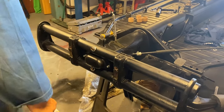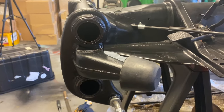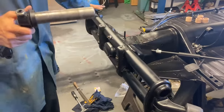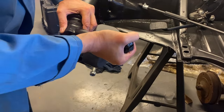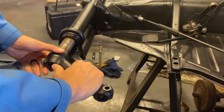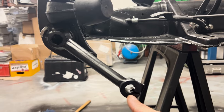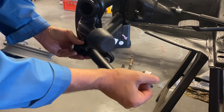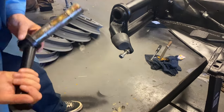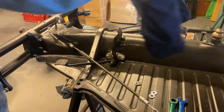We've tested all these bushes - they're all the original Bakelite bushes and they fit lovely. Just on one side I'm not sure why, because that side was toast. But this side has zero play - I stuck a vernier in and it's all the same. I'm happy with that - I'd run any car like that. I have brought replacements but I don't think I'm going to fit them on that side because I'm happy with it.